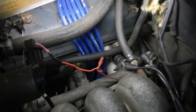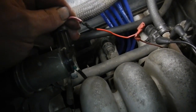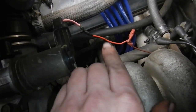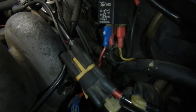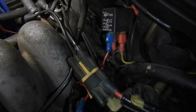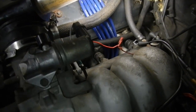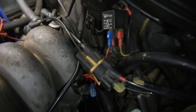Well, the last thing I think I'll do is look at this disgrace of a wiring job, which goes here to the air bypass valve or stepper motor. So yeah, that's just a disgrace. They've cut it there, joined it there, goes around here and just twists into this terminal that goes to that relay. So I'm going to make that all nice. Just that one wire. Not going to go too far, otherwise I'll end up just rewiring the whole goddamn thing. So that's for the gas system to turn this off when it's on LPG. So, that's just a disgrace.